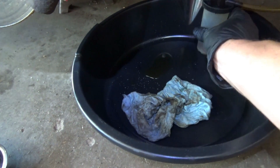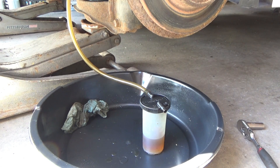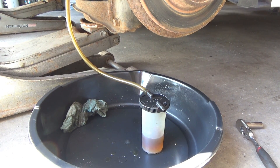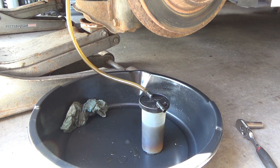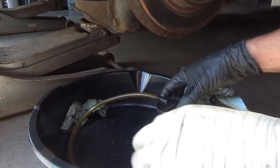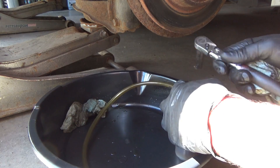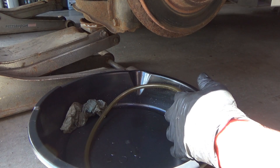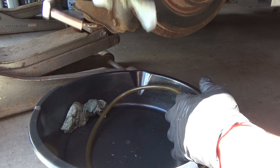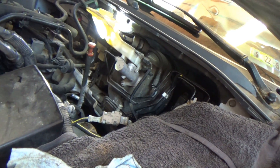I think that one's good. So now the diagonal cylinder — right front — set up the camera and see if there's any air bubbles. Just nice smooth pumps all the way to the floor. This line is shorter so it shouldn't take too many pumps to bleed through. The line has no bubbles in it whatsoever — make sure it's dripping, gravity bleed, tighten that up. Onto the next one — right rear — it's dripping nicely. Left front is last. Don't forget to add brake fluid if you don't want to start this procedure over again.